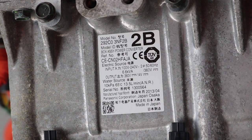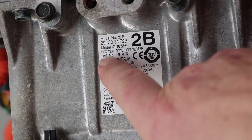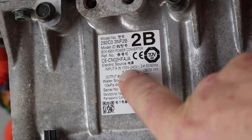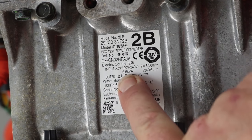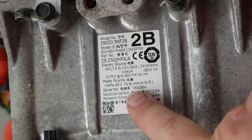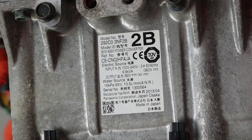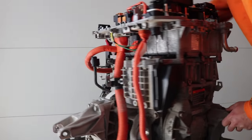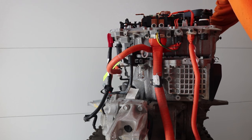I just read the tag on the outside of the charger here. It's marked as a box assembly power converter. Input is single phase or split phase, 100 to 240 volts AC at 50 or 60 hertz. This is the 6.6 kilowatt charger — so this is from a 2013 car and it was not the stripped-down S version. The output is 360 volts nominal and 14 volt, so this will charge the 12 volt car battery as well as the main propulsion battery pack. I've got the black wire harness off. I do still have the orange high voltage battery cables on here, but they're all loose on the end, so I'll just take the whole charger off. There's still a couple of random brackets I'll take off right now.